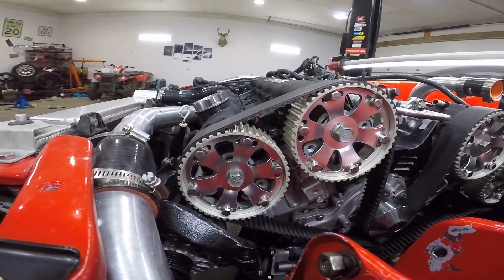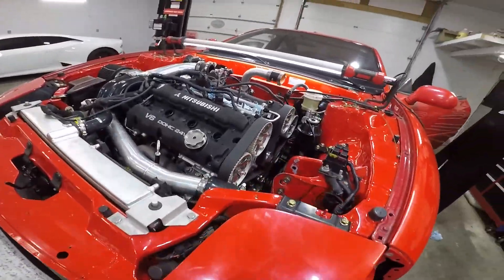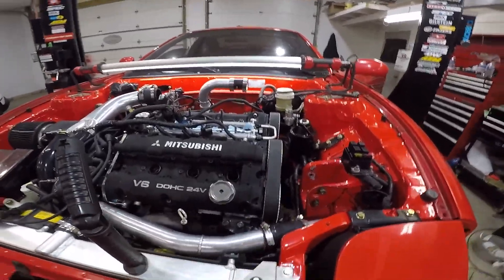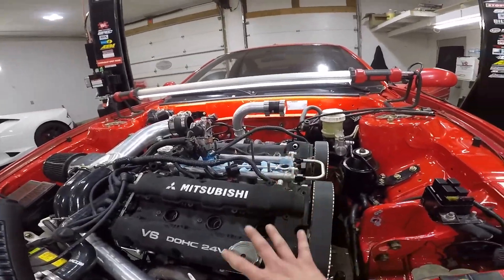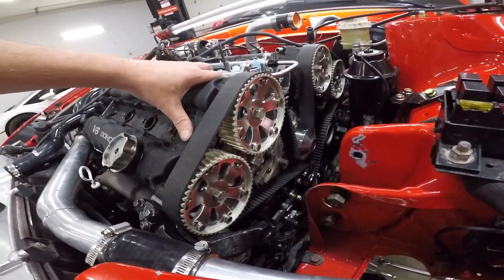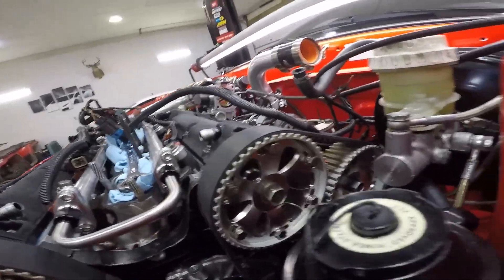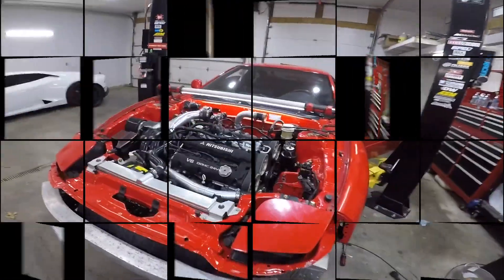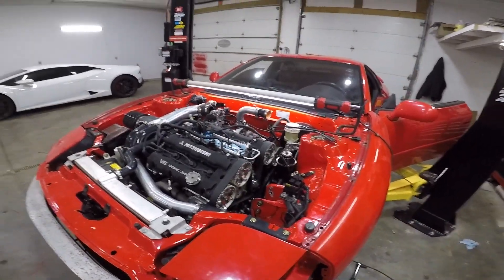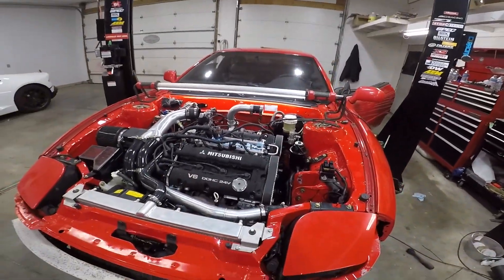Any of that could be variable — the degrees could be off a little, and I know a lot of you have said you've gotten cam gears that were off by a degree. I'm going to have to figure all that out on the dyno. I could bust the valve cover loose again and move it just a tiny bit — if I moved it down it'd be one trillion percent right. But the back is perfect. I'll get my phone in there and get you guys a picture. There are markings on the back. Yeah dude — that's on, it's good. I'm just going to start throwing this back together. I've checked this a hundred times.